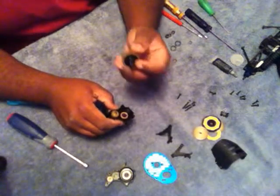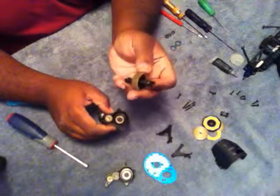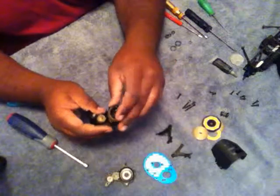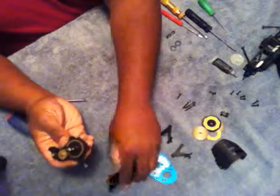I put the head of the bolt on the left side of the car, so I don't have to work around the slipper assembly when I have to adjust the diff. So it's up to you. I think the instructions have you put it on the right side. And just drop that back in.